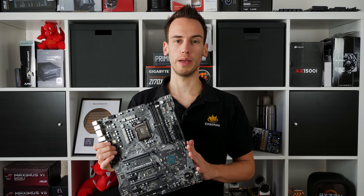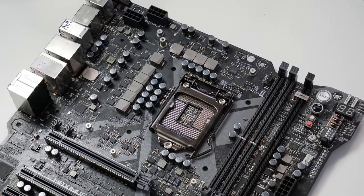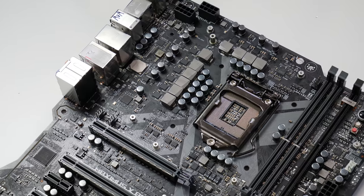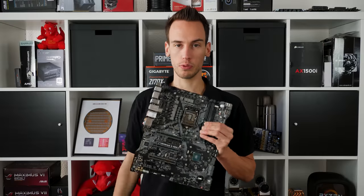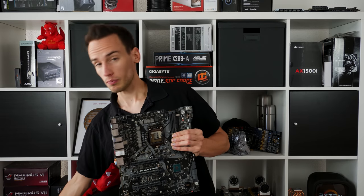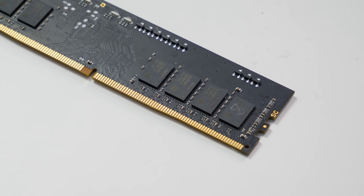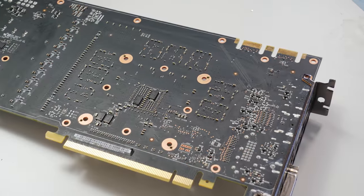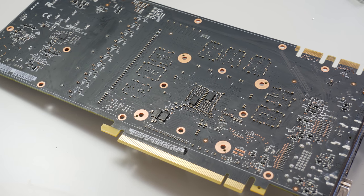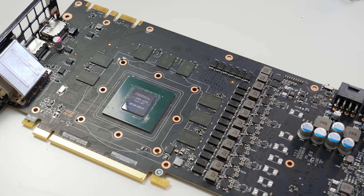Everything dried overnight and looks really clean — mainboard, GPU, memory sticks, no Vaseline residues anywhere. One thing to be aware of: water can leave residues as it dries, which you can remove with a contact cleaner or electronic cleaner spray. I also recommend cleaning all the contact fingers — memory slots, PCIe connectors — with electronic cleaner. You can spray it directly into the socket, memory slots, or PCIe slots. This is also what I use if thermal paste gets into a socket — just spray until it's gone, and make sure everything is dry.